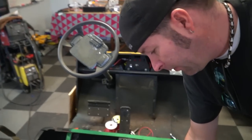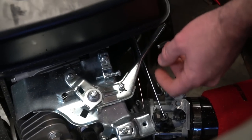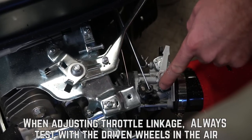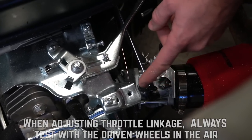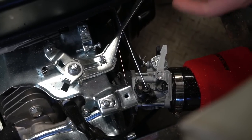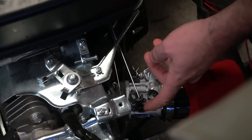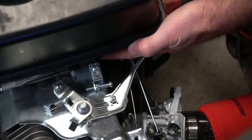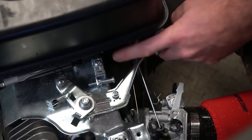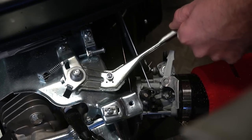The throttle was a little bit too sensitive, so I wanted to make it not as sensitive. I added an extra spring on the throttle return to help stiffen it up — you'd just move the throttle a little bit and the thing wanted to go wide open. The first thing I did when we went to break in the engine was I moved the spring over the shaft to allow it to return to idle. I also added a spring to the governor arm underneath the fuel tank and attached it to the upper starter housing mount. Now it's not as touchy.